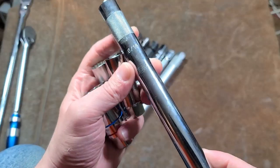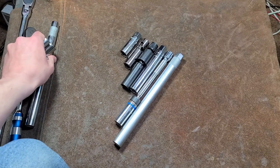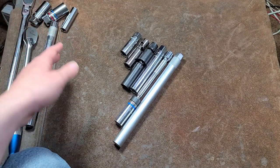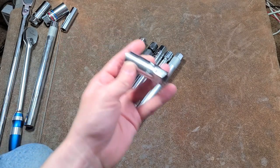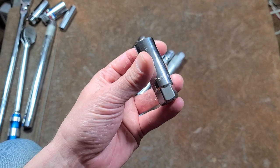There's the other ubiquitous size, the 9/16ths. The 18 and the 9/16ths, I believe, are for portable, small engines — though I may be incorrect. So there's actually a variety of sizes of spark plug sockets. A standard 3/8-inch spark plug socket would be in like a 6-point, so you have better grip, although you can get them in 12-point, 2 and a half inches long.